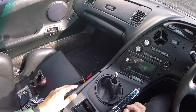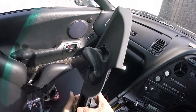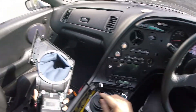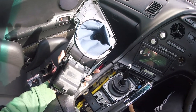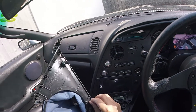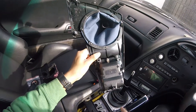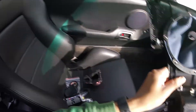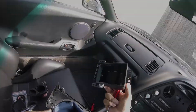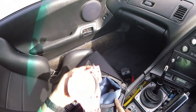Next step, let's get this panel removed — it's pretty easy to do guys. There are a few different clips down here and over there, and it'll be more evident once it's empty. There are some screws: one here, one there, one there, and one here — so one, two, three, four, five main areas. Just be careful of the little pins and clips — a lot of people do snap these when coming off. Now that it's off, let's get the bottom casing off — three screws, just get yourself a screwdriver.